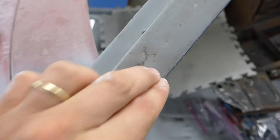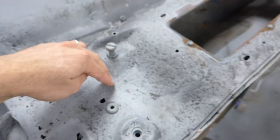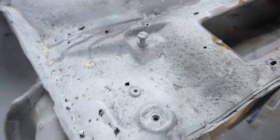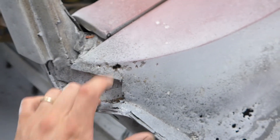At the bottom of the windshield pillar there are a couple little pinholes coming through — the rest of it seems okay, so that might just be a zip-out and replace piece. The cowl over here and all the holes on this side — I have a parts car outside that has this whole section in really nice shape. I'm thinking I'll just zip this section out and put the piece in from the parts car, and that'll take care of it. That parts car also has the adjacent section in good condition. My pick hammer went through here — it's a little rotted — so that needs to be addressed too.